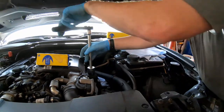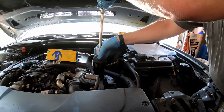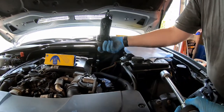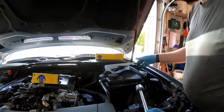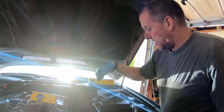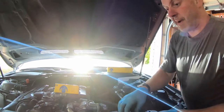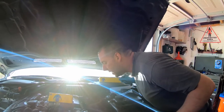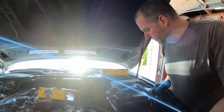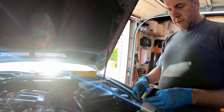I've got some blue tissue just to catch any spills because this is particularly messy. As you can see it's particularly dirty. There was quite a big drip from the sump plug underneath — that's because removing this cap breaks a vacuum, allowing the rest of the oil to sink out. You can hear underneath — more oil is coming out now, which is good.